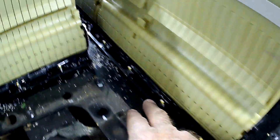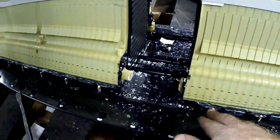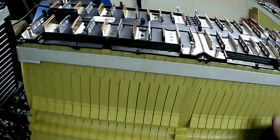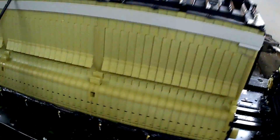There's a little bracket that sits along the edge of each one of these battery packs. You take the nuts off and get that bracket out of there. Then these modules will lift right out. There's a little stickiness underneath — like a piece of tape — that you have to cut loose.